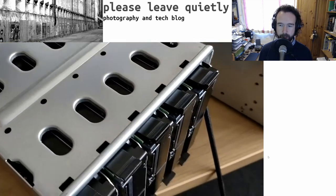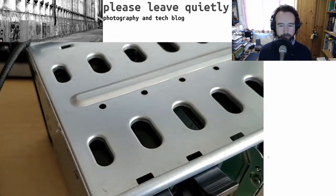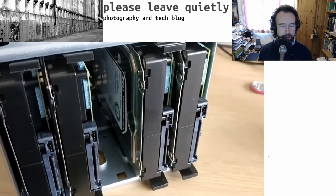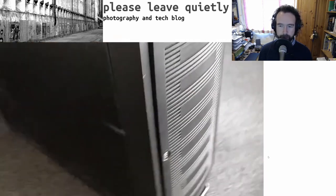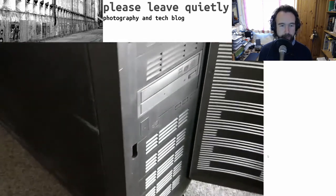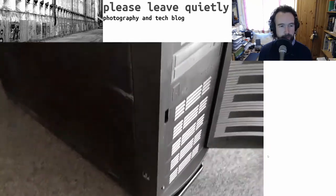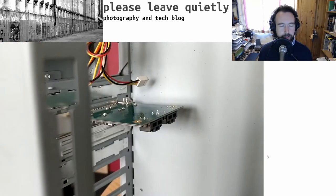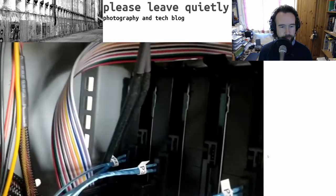There you can see one case populated with five hard drives. The system I've got will have eight functioning hard drives and one spare. There's the other case with four drives and a gap down the middle just for airflow. You can see these are SAS drives, which you just have to bear in mind when it comes to powering them. This is the case I'm going to put it all in - it's an old rack-mountable case but also tower-convertible. I'll take the rack mounts off and mount the drives in. And this is a pass-through card which the mini SAS connectors will connect to.